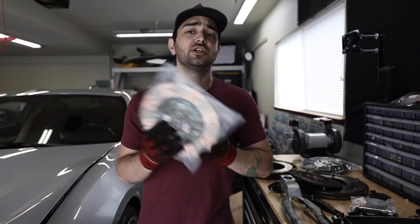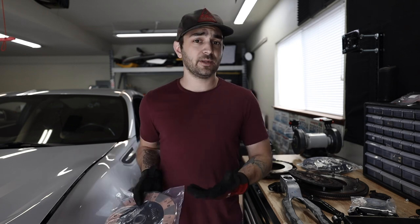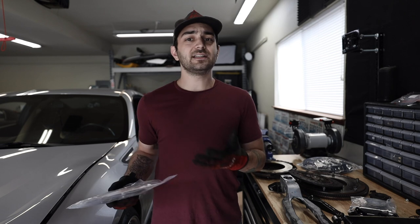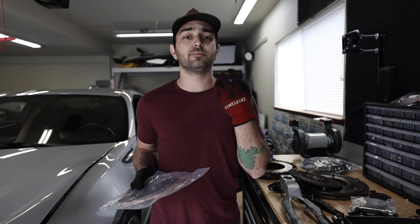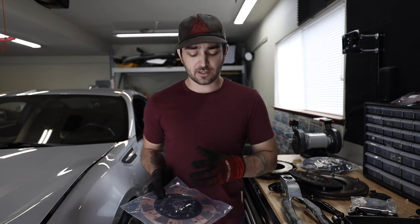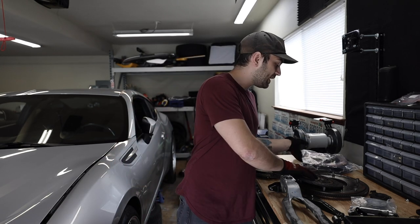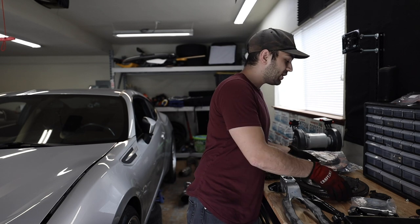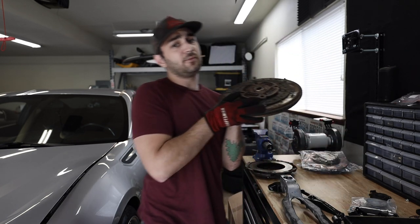So the friction pads are generally made up of either a carbon ceramic material or an organic-based material. The reason they're there is they're high friction materials, which is what you want in a clutch. So when your clutch starts slipping over time, it essentially means that all of the material around the clutch is starting to fade off. Oh, sorry, this flywheel's really heavy.